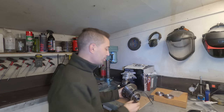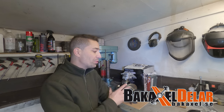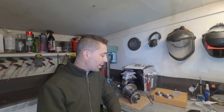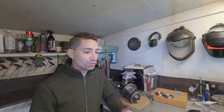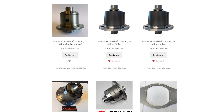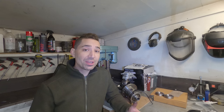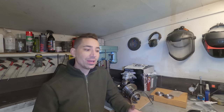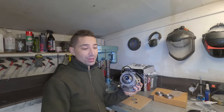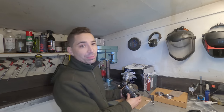I owe some thanks at the beginning of this video to a guy called Jonas from Bock-Oxeldele in Sweden. I've been communicating with Jonas for quite a while and I've been sitting on this locker for almost a year. It's not paid promotion - I paid what Jonas paid for it. He isn't stocking them just yet but wants me to install it, test it, and give feedback on whether it's worth putting in his shop. His website mostly deals with the drift scene and he makes a lot of stuff for the Dana 30, because a lot of Volvo rear axles are Dana 30s. He actually manufactures a torsion diff that does a 27 to 30 spline adapter, so you can swap out the ends for 27 or 30 spline, which works great if you're upgrading to 30 spline shafts and unit bearings.